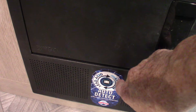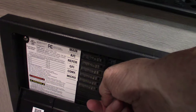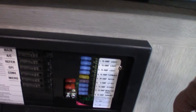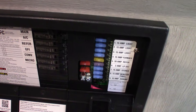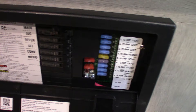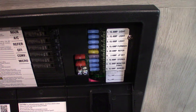This device is your power converter — it converts AC to DC power. When you're plugged into shore power, it first detects the type of battery you have automatically. You have a control panel for AC current with 110V AC circuit breakers, all labeled just like at home. Power is then converted to 12-volt DC on the other side, with 12-volt fuses, all labeled. It also acts as a battery tender — it'll sense how much energy your battery needs and send the amps necessary to keep it charged.